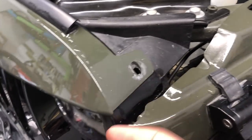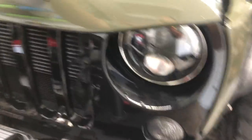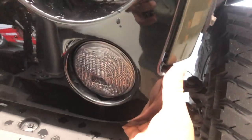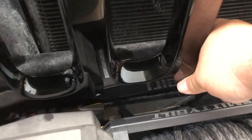This removed the grill as well as the Nighthawk piece. Don't worry if you lose the push pins — they're not very expensive, AutoZone usually has them. Now once you have all of those push pins pulled out, the whole grill is going to be loose. As you can see, it's just held in with some clips here — they're pushed in, so you can pry that out. Right on the radiator support there are some more push pins. Just wiggle them — you don't want to break them, they will come out nice and easy. No special tools needed, and the grill is free.